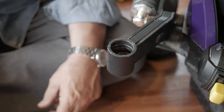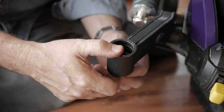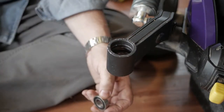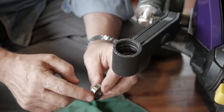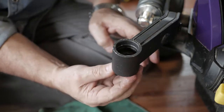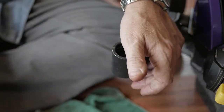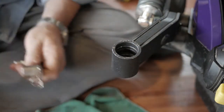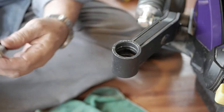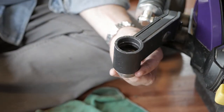Once that is out, we can go to putting in and replacing the bottom bearing first. But before I do that, I would like to do some lubrication. I'm going to put a light coat of oil over the outside of the bearing set just to help it slide into the caster housing. Then we're going to use our socket over the old top and gently tap it back into place.